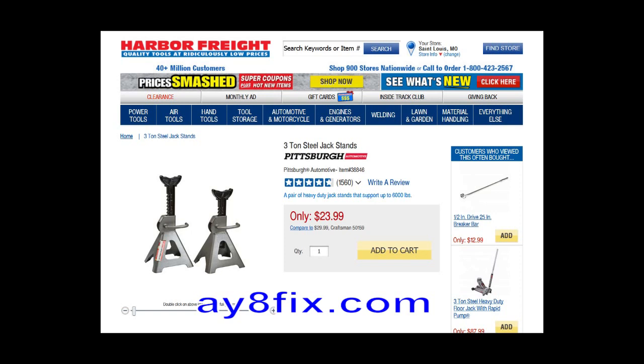made by Pittsburgh. Safety has to be in mind at all times when you're working under a car. Sometimes the jack you have may not be sturdy enough to keep the vehicle up, especially the time it takes to drain oil. Some jacks lose their pressure, and you just don't want to take a chance of somebody walking past and bumping the vehicle or whatever. So a good set of jack stands will hold the vehicle secure, and you can still have the jack under the vehicle for rapid deployment.